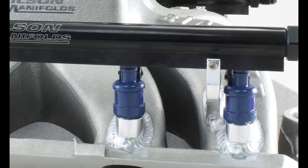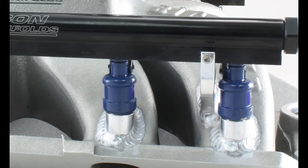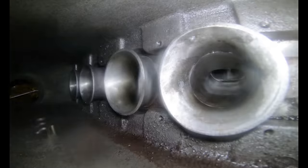Just a quick touch on the Sniper lineup — that's an entirely different subject for another video, as they have a ton of models, part numbers, and even different colors. In my personal opinion, if you're going to spend the time and money converting to fuel injection, I would strongly encourage you to spend a couple extra bucks, convert your manifold over to port injection, and use one of the ECUs covered in this video — especially if the engine is extremely modified or you're trying to make big power. If you want a video comparing the Sniper ECUs, let me know in the comments.